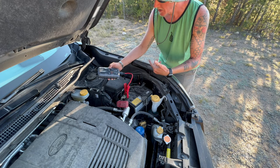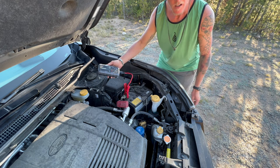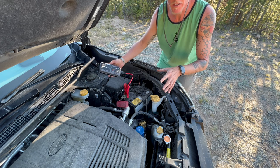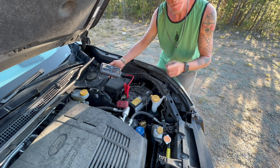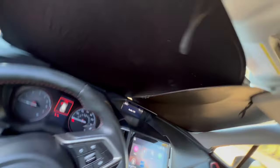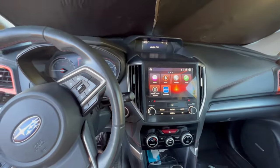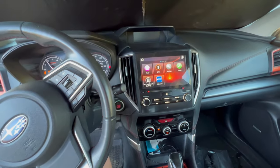I've got my alligator clamps on my battery. I'm going to go ahead and turn this on and it should get enough boost to the car. I can actually hear some of the things in the car starting to engage a little better — the locks and the tailgate making a noise — so I know this has done its job. Let's go ahead and try to turn over the engine. Already I've got a better sound. I have sound from my door being open — that was not happening before — and all my lights are on. That's a much better sign. We're going to go ahead and fire this up. And just like that, the car starts right up.